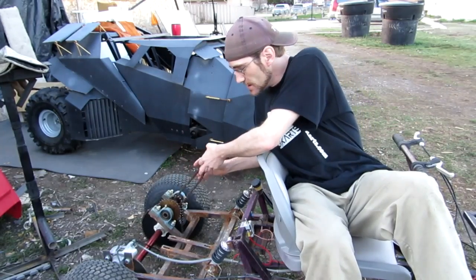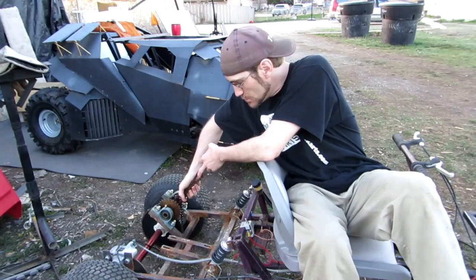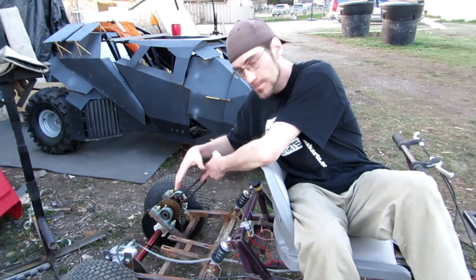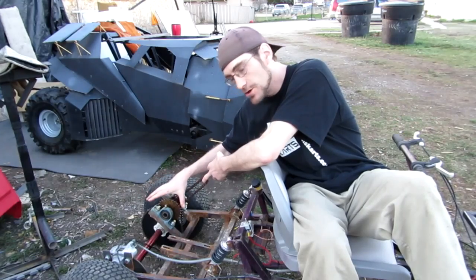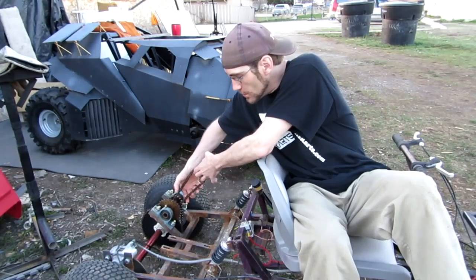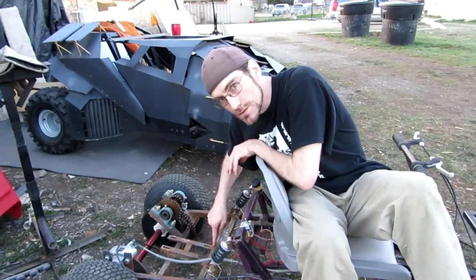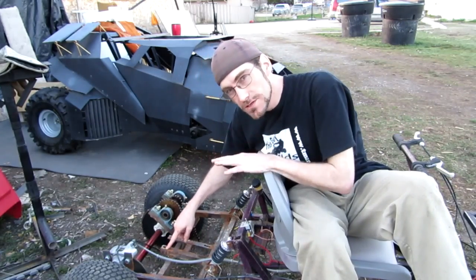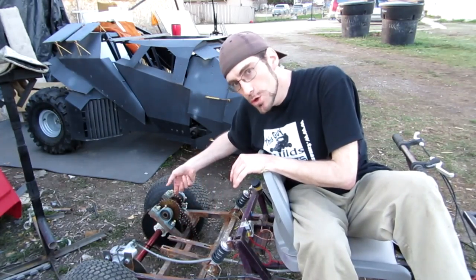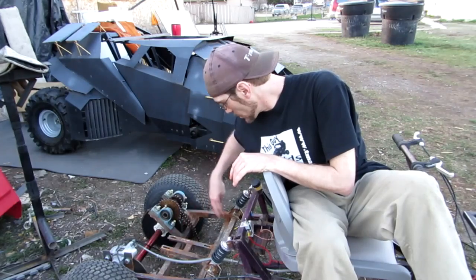Now let's say everything looks lined up and your chain is connected to your engine. If you grab your chain and squeeze it together and your engine moves closer, that's a problem — when your engine is running and delivering power to your axle, they're trying to squeeze together. If your engine moves a lot when you squeeze the chain, check your engine mounts, make sure your bolts are tight and your engine is aligned right. If it's still moving, chances are one of the welds has broken underneath the mount or on your support bars.